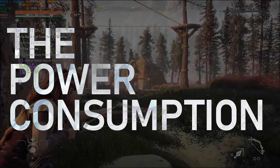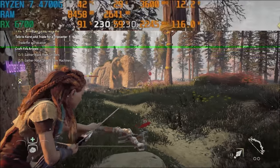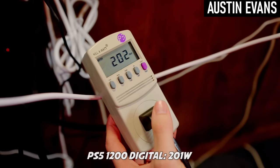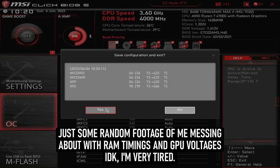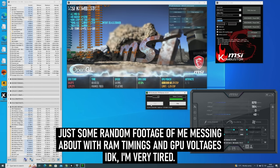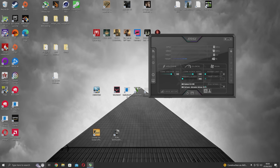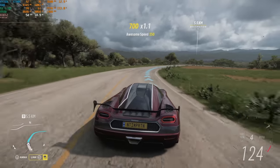As you can see from the Afterburner overlay, the Ryzen CPU is sipping power most of the time, and with reduced clocks, voltage, and power limit, the Radeon GPU tops out at between 110 and 130 watts. A reading from the wall during a canned Forza benchmark saw the total build drawing around 230 watts, which is on par with an older model PS5, and 20 to 30 watts higher than the newer models. I'm pretty satisfied with this, but if I were going to make a bigger deal about it, I might start by dropping the RAM to lower clocks and looser timings to run it at 1.2 volts rather than the 1.4 set in the XMP. I'd also spend more time refining the Ryzen's power settings. The GPU itself is probably as low as I'd want to go, with the clock set at 2400, power limit to minus 6% and core undervolted to 1160 millivolts, though if I were happy with lower performance and relying more on upscaling, I think that would be the most effective way of hitting the 200 watt mark.